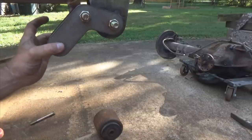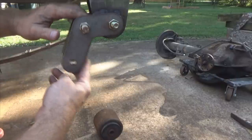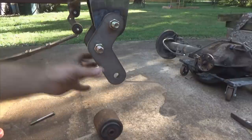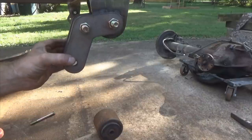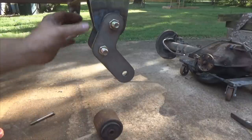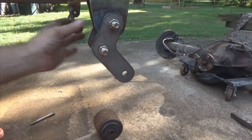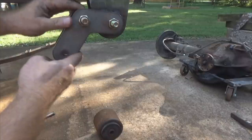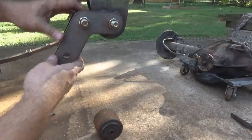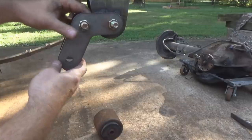I've got my center brace here, so whenever it comes up too far it hits the brace and stops, preventing it from going too far. I still think I'm going to put some gussets from about here to about there — roughly 45 degrees — to limit travel a little bit more and give more bracing, while also allowing a bit more shackle travel.